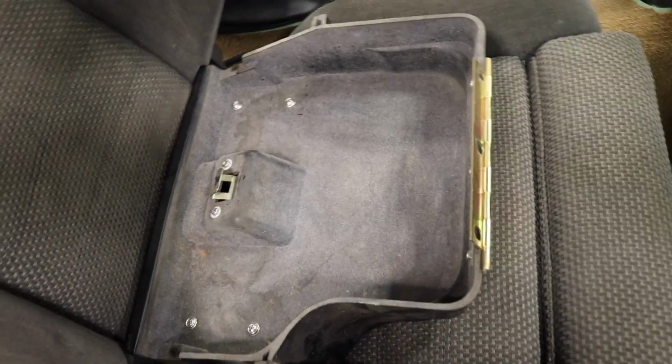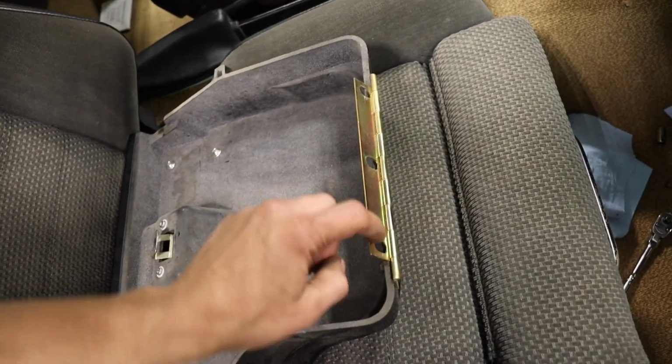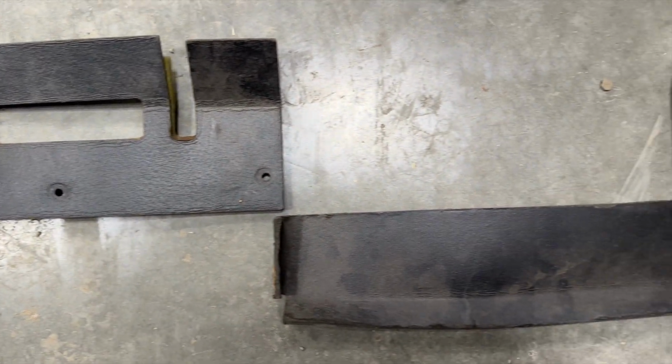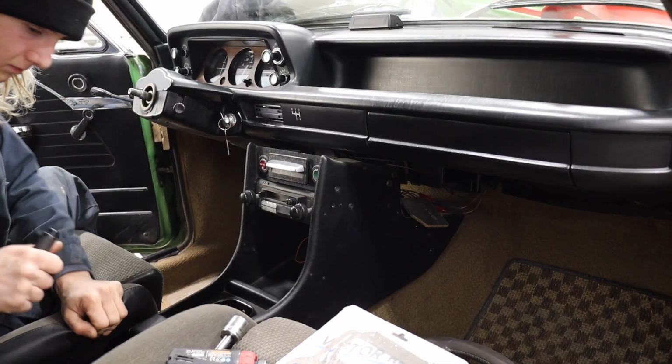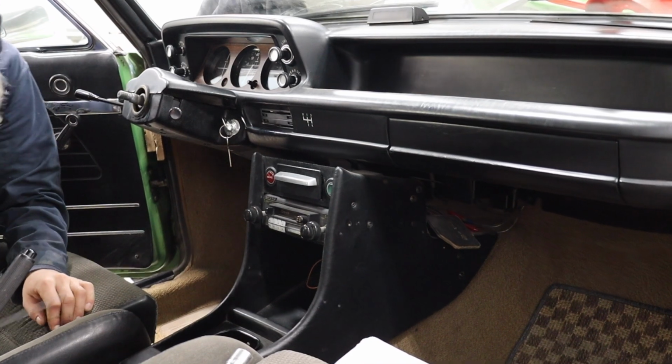To take out the heater box, you have to take out the glove box as well. There's three little 7mm screws at the back here. Now, if your car still has them, you'll need to remove the under dash panels. These are originally held by a few Phillips screws, although Mr. 90s stereo shop guy probably used anything and everything.